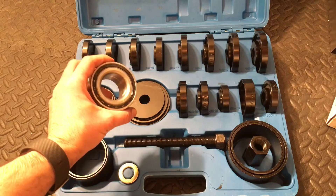You want to find the right adapter that will pretty much cover the entire surface of the bearing. Let's go with this one here — this one looks about the size of our bearing. You want to make sure that the centerpiece drops into the inner bearing race where the hub shaft or spindle will go through. Let's take it over there and check it. If not, we'll come back and pick the next size. That's a perfect fit there — see how it's fitting exactly over the bearing, with the centerpiece dropping right inside.